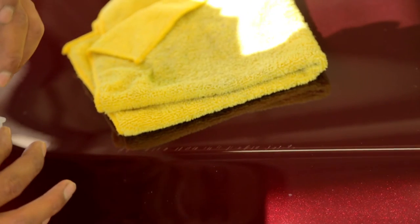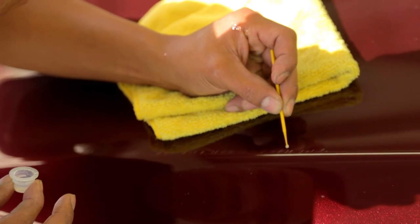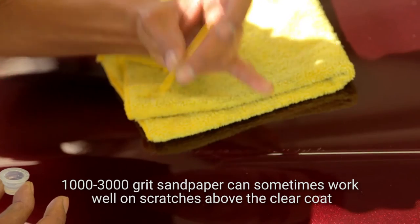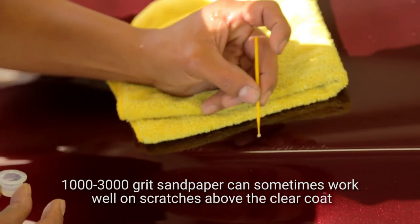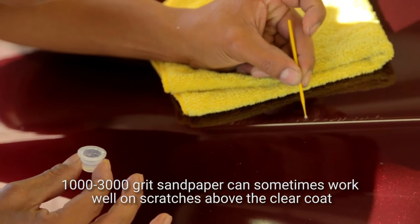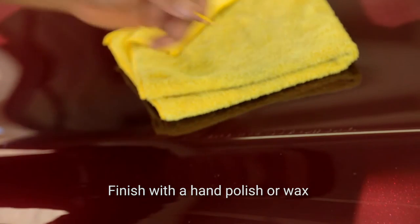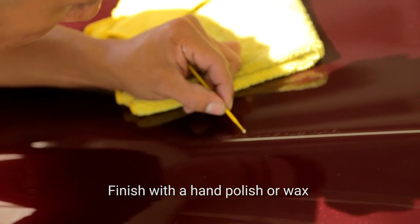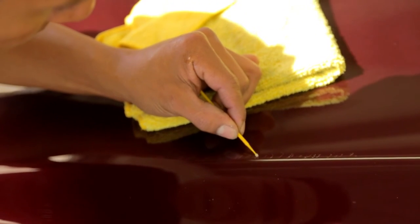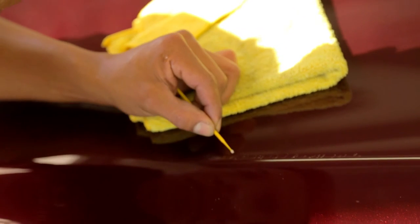What the clear coat does is allow the base coat to cure and it allows it to shine and to match better the overall appearance of the rest of the car. On a scratch that is not completely through the clear coat, you can sand that out with 1,000 grit sandpaper, sometimes 2,000, sometimes even 3,000 grit sandpaper depending on how deep the scratch is. That'll dull out the finish and flatten out the clear coat to match up on each side of the scratch. Then you can use either a hand polish or a wax to bring the luster back to that clear coat and you'll never even see where the scratch was. If you don't feel comfortable doing the process like that, it's probably best to stop by — it's a fairly inexpensive repair, but you can actually damage the clear and the paint if you're not comfortable with sanding.